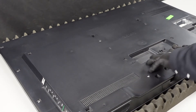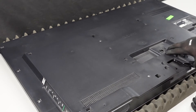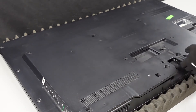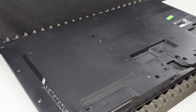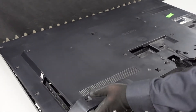Next step — kind of feel around, see where it has some give. Make sure you don't have any other screws connected to it. It feels a little tight on this side. Taking another look — it looks like we should be able to get this up relatively easily. Let's start at the bottom where it has more give, and you can feel those clips lifting up around the frame. This is why we're gentle — there's a screw right here, kind of camouflaged in, so let's get that removed. Shimmy up the side; you can feel it popping up. Go down this side and hear those clips coming right off.